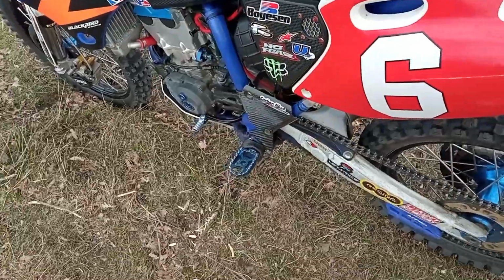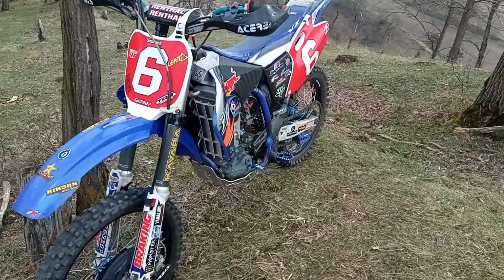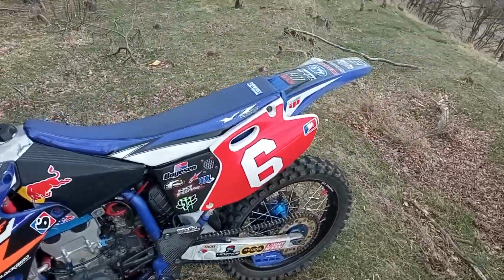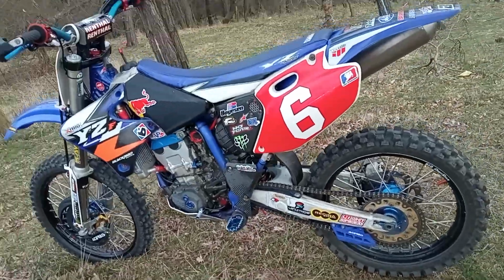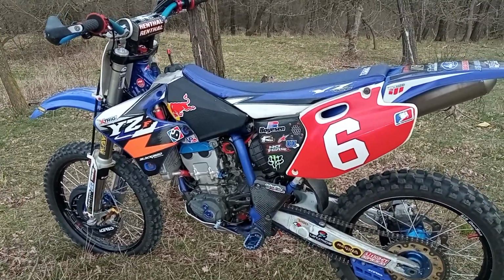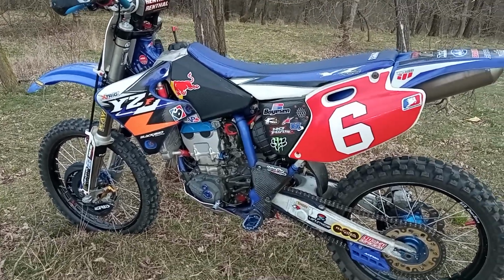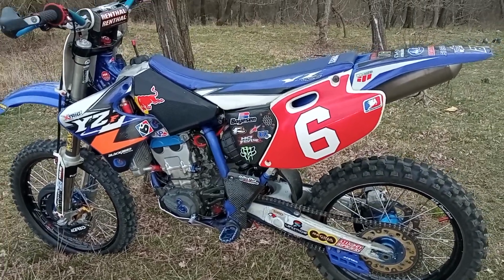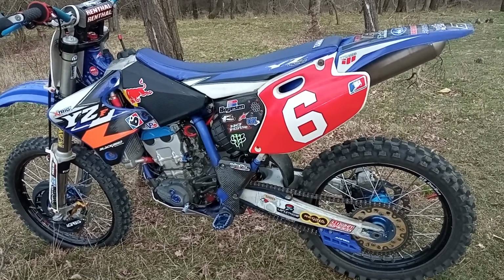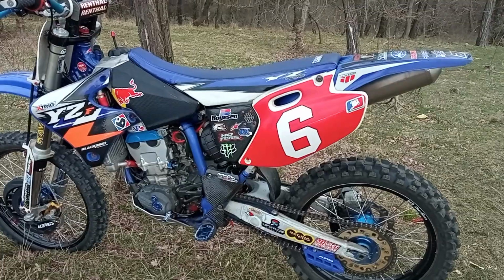But other than that, from my point of view, it's a bike that, if you know how to take care of it, and you know how to explore it and make regular changes of oil, and keep up the chains, the sprockets, and the wear, the suspension as well, if you change the oil, change the springs if you need to. Yes, maybe for some of you, the valving on the forks or in the shock is a must, but I repeat, for what I'm doing, only changing the springs front and rear helped me a lot on balancing the bike, on adjusting the bike the way I wanted.